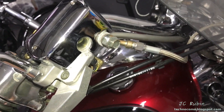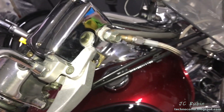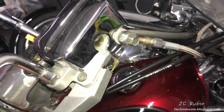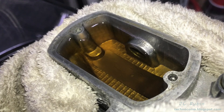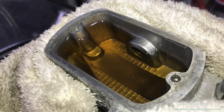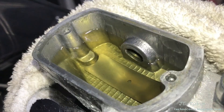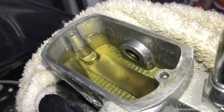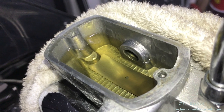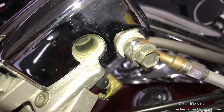That completes the bleeding of the front brake calipers. Naturally everything should be checked and double-checked for leaks, and that everything is operating correctly — that the brake lever feels good and should be tried out to confirm the brakes do in fact stop the bike before taking it on the open road. If you feel uncertain about any of the work you've done, by all means take your bike to a professional. Don't take it out on the highway to see if your brakes are operating correctly. I hope you found this front brake fluid bleeding procedure to be helpful — thanks for watching.